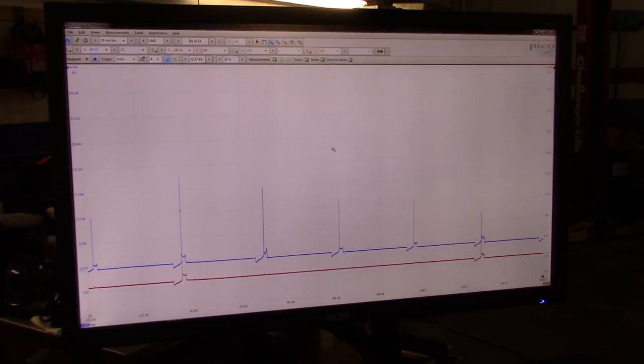Okay, so let me stop here and think about what I need to do with this car, because definitely we have no misfires. I mean, that boot got a little bit of a misfire in there because of the water. I'm going to recommend replacing those boots if possible, and I'm going to inspect it a little better. It happens only in cylinder number 1, and that's the one with the fewest misfire events counter-wise. Alright guys, so let me stop the video here and think about what I'm doing.